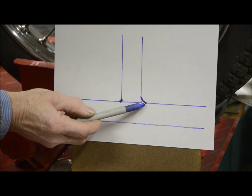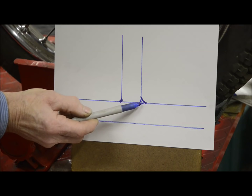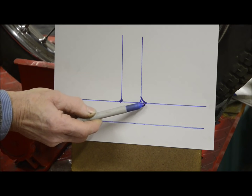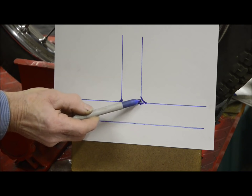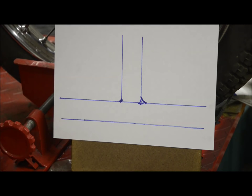Just like solder, when you touch it, it will run where you fluxed in its completely molten form. But then, by easing the heat off a little bit, you can actually begin to build it up. It's a semi-solid state. Where this really comes into its own is with triangulation.